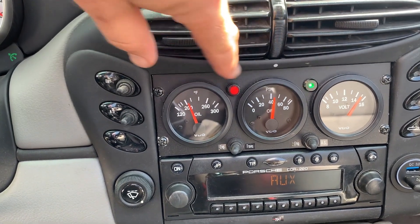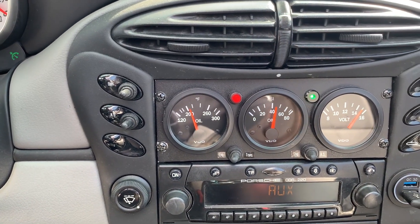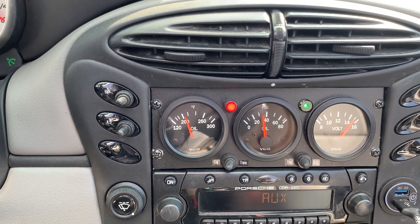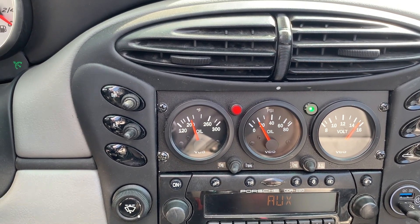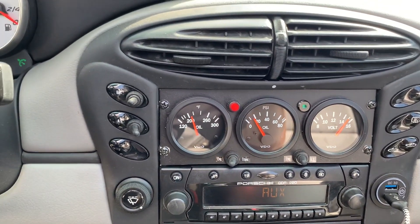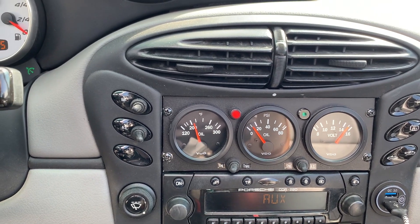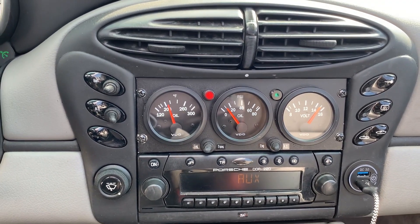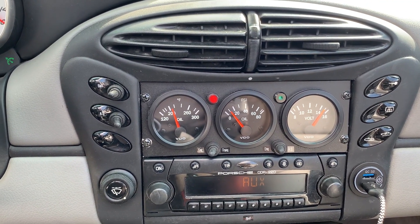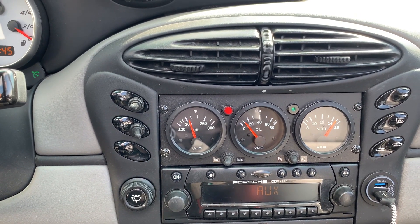You'll see a green light here — no oil dump. If I let the RPMs down, you'll see the red light goes on as the AccuSump is actually dumping into the system. So what we're going to look for on the track is: does that AccuSump dump in the corners under high G loads when that oil is getting sloshed around in the oil pan? In other words, is the AccuSump helping to preserve the oil pressure in high G corners? So let's take a look.